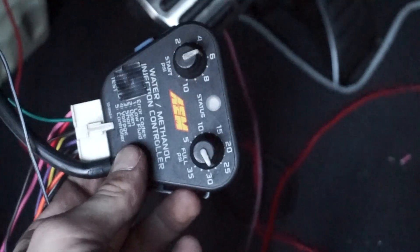I'm also going to run to the store and get an LED. The LED will flash at the same time as the LED on the controller — I think I'll put it up here on the dash. The LED will be lit up when the pump is spraying, and it will flash when the controller senses the tank is low on fluid.